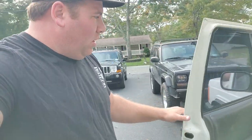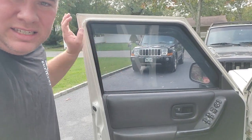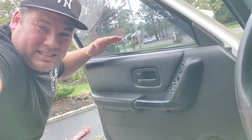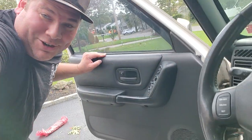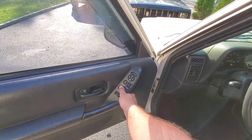The first step is we're going to remove everything that's on this door because this is all good stuff. We've got a nice door panel, all the electronics are great, the glass is good, we even have our nice little rain guard up here. We're going to start the removal process by turning on the ignition and dropping this window down to the sweet spot for accessing the window regulator.